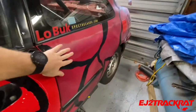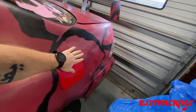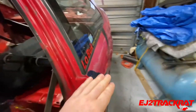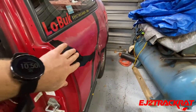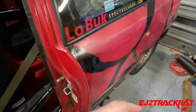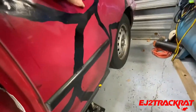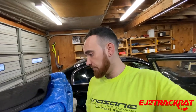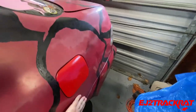So this is dented — this is all from when I crashed my car in a qualifying session on a cold, damp track at NJMP Lightning. There are two options: the first is to fix it myself with Bondo. If the quote from the body shop comes back too high, I'll probably just take a dent puller and slap hammer all these dents out. The way we originally fixed it was with a basketball and a soccer ball and an air compressor — we put it inside behind the fender and inflated it multiple times in different spots to push it out. I also came back with a hammer on the inside, but you can see it's still pretty wrinkly.